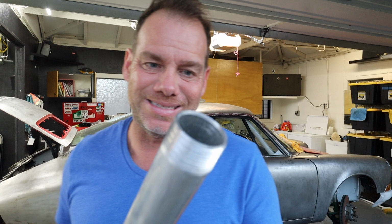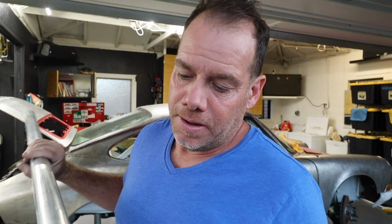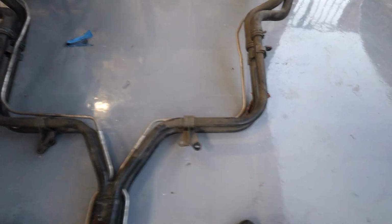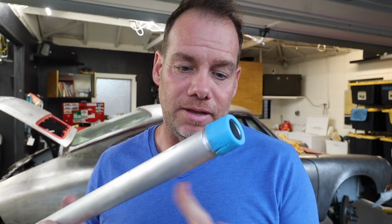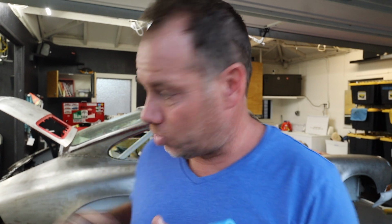One of the factors is this original pipe that I got, which is 1.25 inches inner diameter. I think it's a little bit too big because if you look here, these are the original Porsche OEM lines from the 996 and the Boxster and the Cayman. They're actually only 1 inch wide. So I have picked up more aluminum conduit that is 1 inch, and I'm hoping that that's going to be plenty. I mean, it's got to go all the way back to front, so there's going to be some cooling capacity just in the length of the tube.